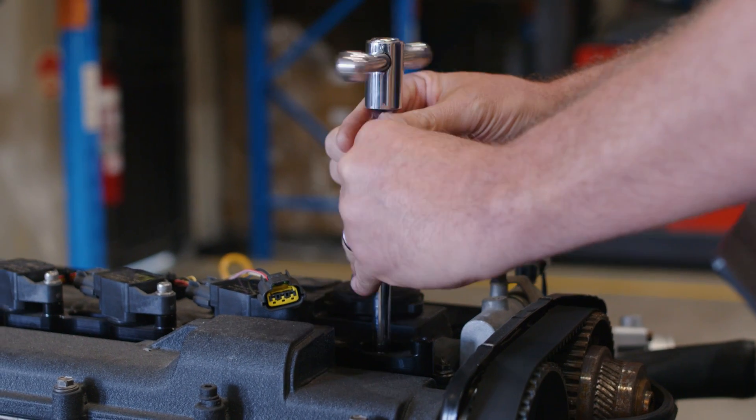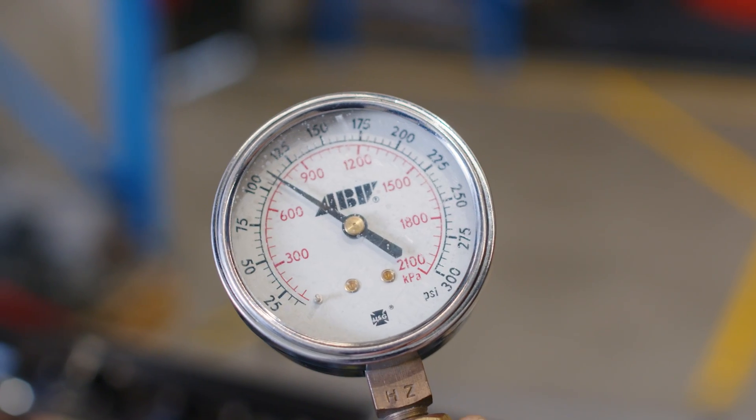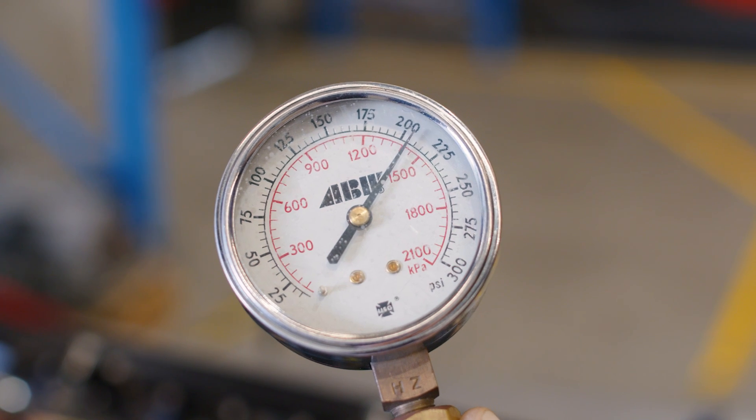If there's any concerns, they'll use a compression test tool to measure the compression of each cylinder to ensure each cylinder is equal and giving a pressure reading consistent with the engine's compression ratio — somewhere between about 125 psi to 250 psi depending on the engine. Equally important is that each cylinder's compression reading is the same, showing each cylinder is pulling its weight. Anything more than about a 20 psi difference between cylinders tells us something's gone pear-shaped. To check compression, the engine's warmed up, spark plugs are removed, and the injectors and crank angle sensor are unplugged. The tool's screwed into the spark plug hole one at a time, the throttle's held open, and the engine is cranked until there's no longer a pressure increase on the gauge. Each reading's recorded, and it's handy to look back on this in the future if we encounter another problem.